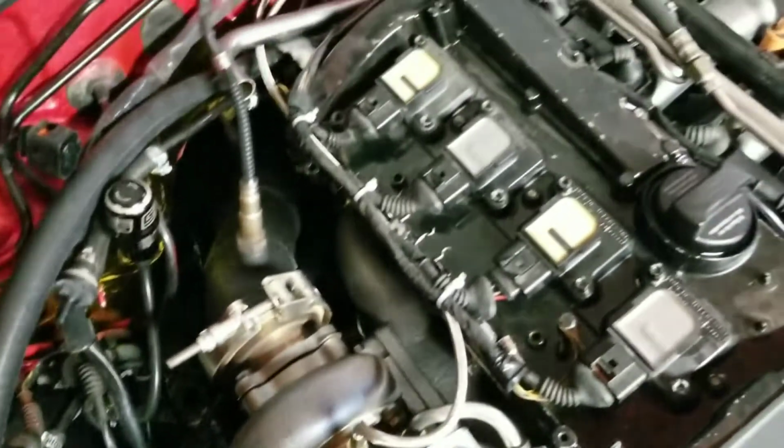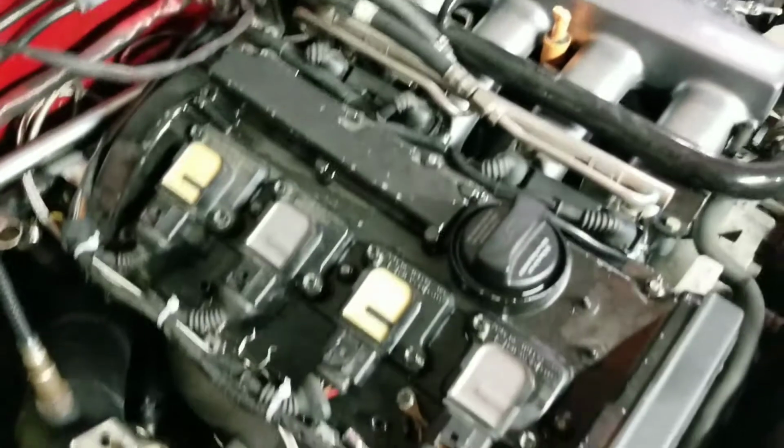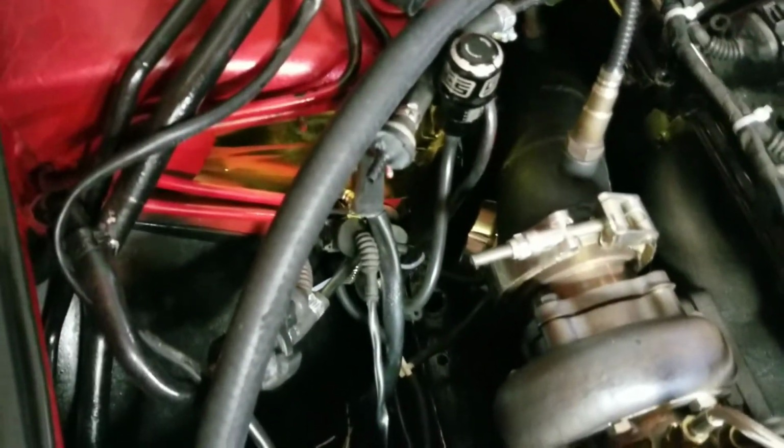This is an external wastegate, which is down there. On the eBay manifold, I did have to get a 90 fitting, because I think this manifold was meant for a Volkswagen Golf with the transversal mount engine, because it hits on the motor mount, but it fits there with the little 90-degree bend. And I also had to extend the mass airflow. That's another thing you gotta do.